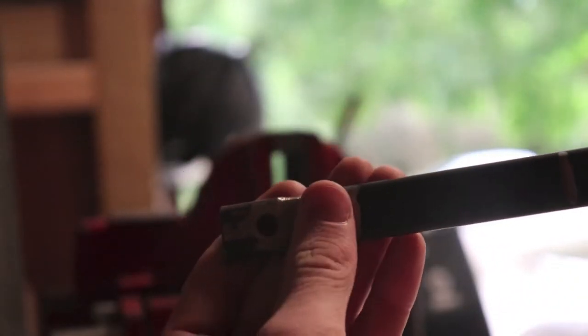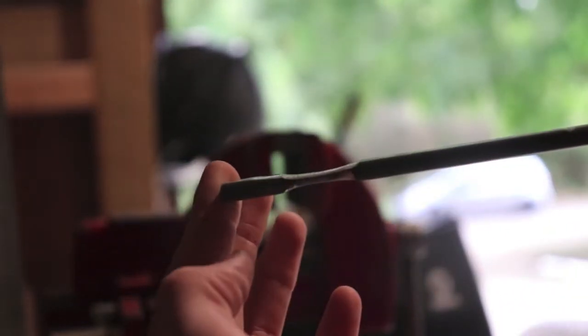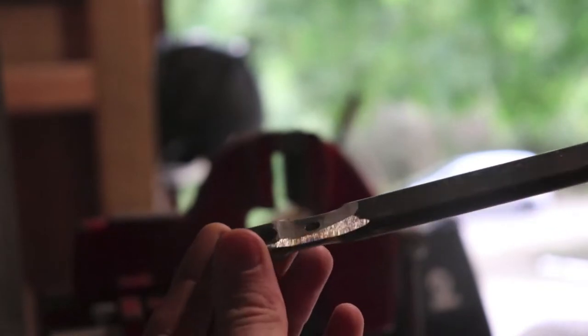All right guys, so I had to do a little bit of work off camera. The throttle cable was loose, so I took a couple hose clamps and mounted it up, and there was just a lot of adjustment stuff I had to do there to get it where I wanted it to be for the pedal. So the next step would be to weld up those two nuts and then put the bolt through and then weld the other piece off. I forgot to say that I ground this down so that the throttle cable could fit through. That's just another thing I did off camera.